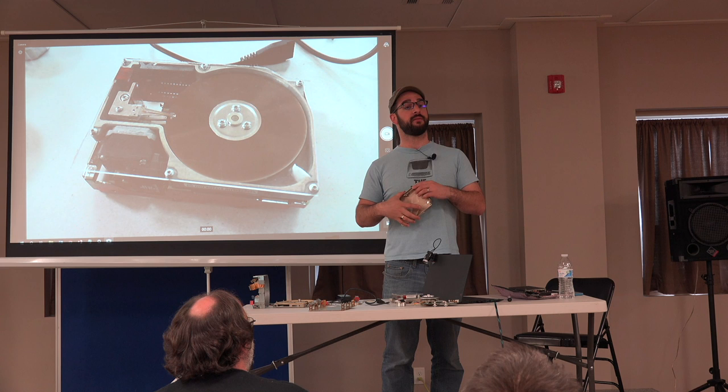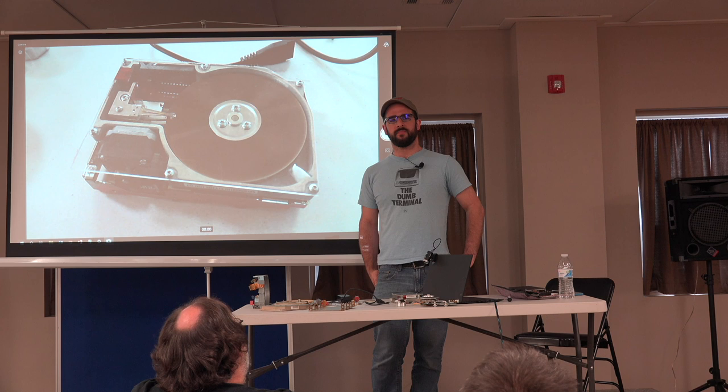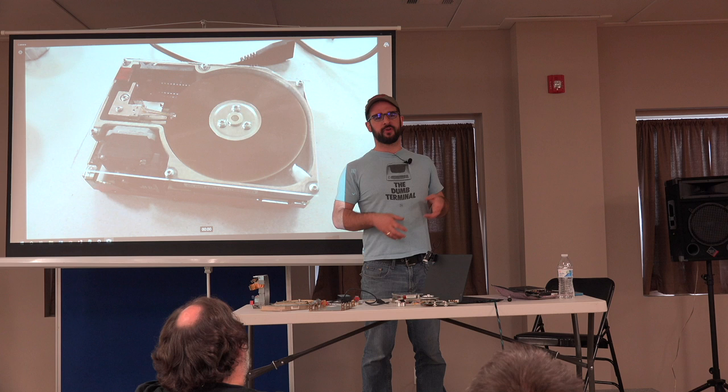Yeah, I thought they actually sputtered something different on the surface of this, but I stand corrected. That might be the case for some of the later ones, but no, it's the same thing. It's all binning. That was the word I was looking for. It's binning for the R drive. You put the best platters, the best heads and the best circuit board in it, and the ones that are okay went into the standard drive.